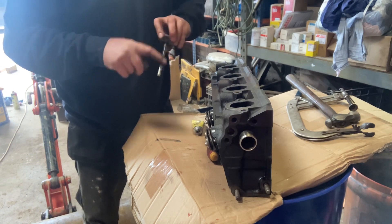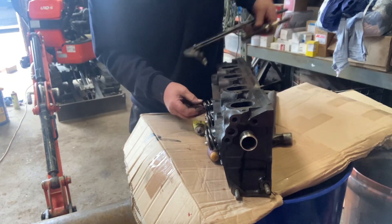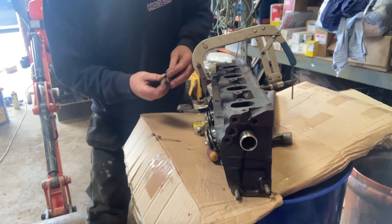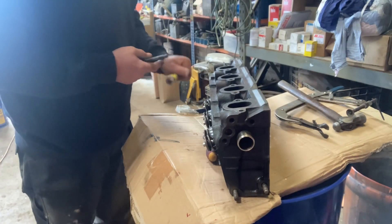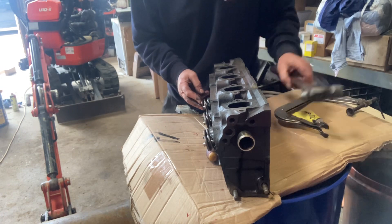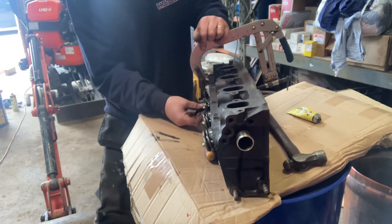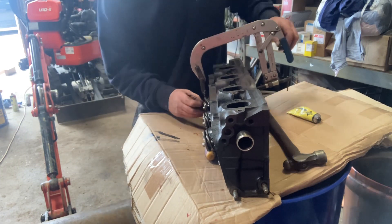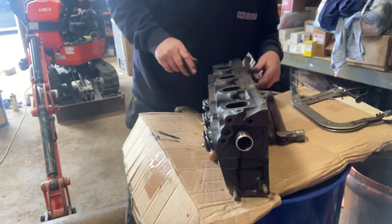Here's something just to get your head around. If you're running your engine at 2500 RPM, the crankshaft is rotating at 2500 RPM. The camshaft runs at half engine speed, so the camshaft will be rotating at 1250 RPM. That means each one of these valves will open and close 1250 times a minute — which, if you divide it down, means each valve will be opening and closing just over 20 times a second.